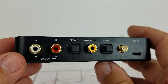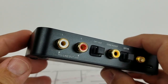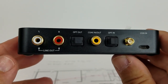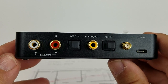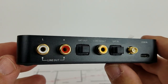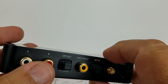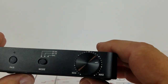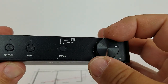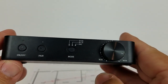Here's the real reason why I was interested in this. It has an advertised rating of 3 volts RMS output, and I wanted to put this in my car stereo. I have an elderly — about 15-year-old — Alpine 9857 receiver head unit with auxiliary input. The auxiliary input is a little deaf, so I wanted this extra bump in preamp level voltage to get the right output level match. And this worked exceedingly well.